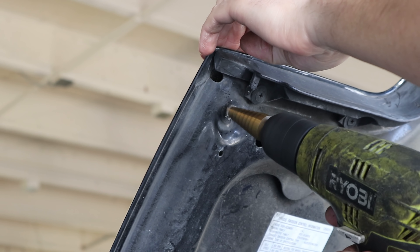Torqued to spec — brake pads are on both sides. Now I gotta bleed the brakes since I disconnected the whole brake line, so I'll add fluid and bleed the whole car. Brakes are now bled. Last thing: hood pins. The engine is sitting up and hitting the hood — I think it might be from the hockey puck motor mounts — so I'm just going to cut a little space in the hood so it clears. Then I want to put a hood pin right there and one in that corner as well.